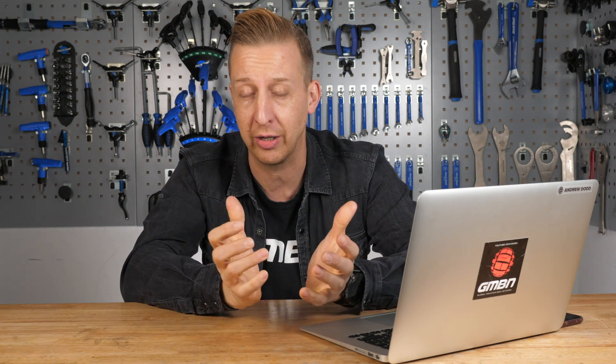I don't know your details on your particular bike — it could be one on the drive side or one on the non-drive side, but I think you'll find that's probably the solution. You put one of those spacers in, then put your cranks on. They should bottom out completely when tightening up, and you should be able to tighten it insanely tight while still being able to freely spin them. It's nothing to do with being left foot forward or right foot forward. If your crank's not installed properly, that is a symptom of it.